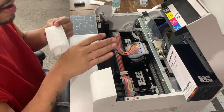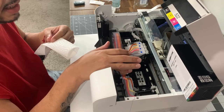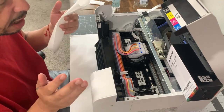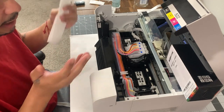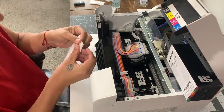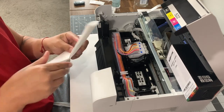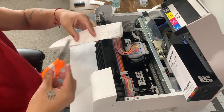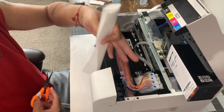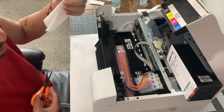I'm just gonna do a process of elimination — I'm gonna pull a little bit of ink out of every line. I don't care if I waste it at this point, because I'd rather spend fifty-something dollars on more Cosmo inks and be done with it. As long as it comes out clear for me, I'm good. If something does go wrong, you either buy a printhead or whatever the case would be. To unlock the head, send something to print, and right before it starts printing, unplug it.